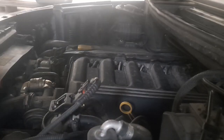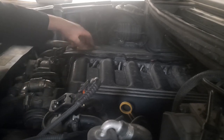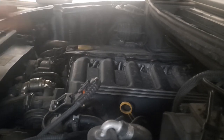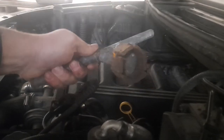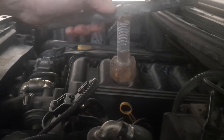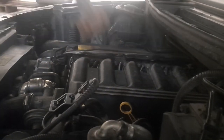So before I go draining any oil out of this thing, I'm going to make sure that I can remove this plastic oil filter housing. You should always check that you're able to refill something and change the filters before you drain it, and find out afterwards. So I'll just get the tool for that. This is the tool that my late father-in-law made for me many years ago for the plastic filter housing on my Jag that I had at the time, and it turns out it fits the BMW as well, which is useful.